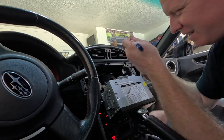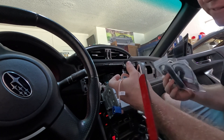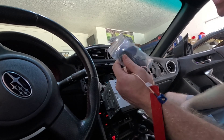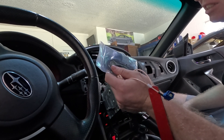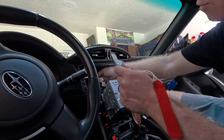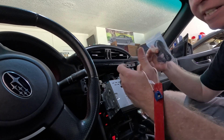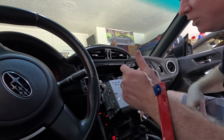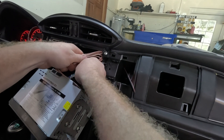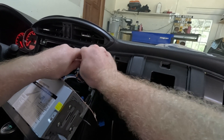One more thing I realized I didn't quite do right — I need to install a couple of accessories that come with the head unit: the Wi-Fi antenna, GPS antenna, and microphone. You don't have to install all of these, but if you want certain features to work, you'll need them. There are also adapter kits you can buy online to make your factory antennas and GPS work with the new unit. I'll put links down in the description. Let me fish this through here, bring this out, wrap the zip tie back around it, and we'll shove it back up in there.